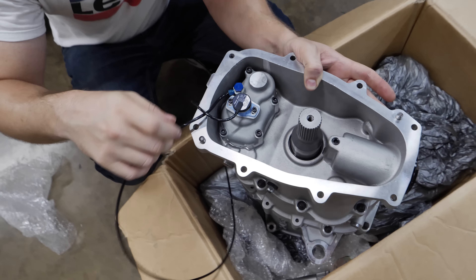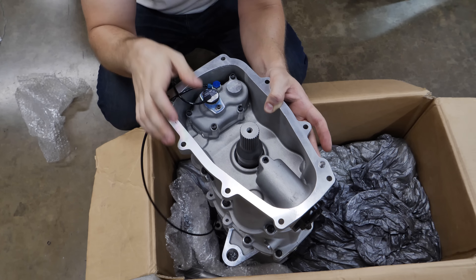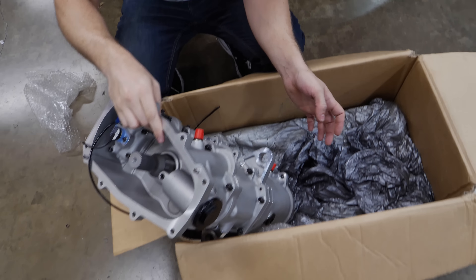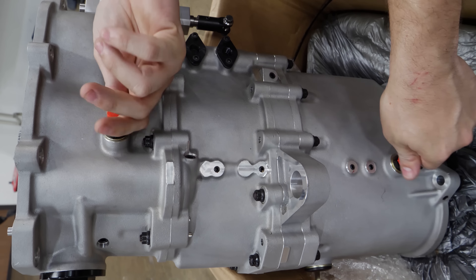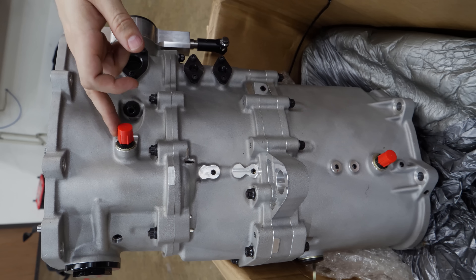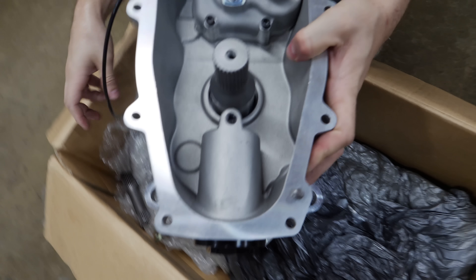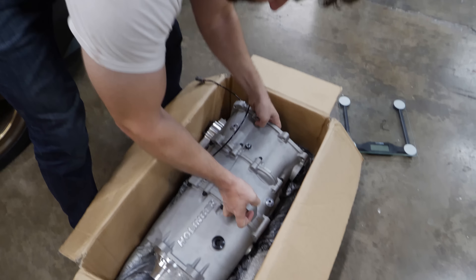This is actually just a breather tube that you wire up so it can expand and contract the remaining air and fluid. It's obviously going to take trans fluid inside that I'll have to figure out how to run. These two are just little 6AN fittings — you can run this with those plugged, or that allows you to run a transmission cooler and fluid pump so you can really endurance race this transmission. That's what it's used for — long-haul racing where you're just slamming gears and going crazy, and the transmission stays cool.